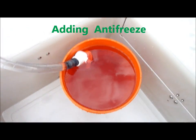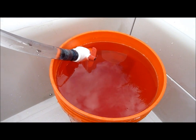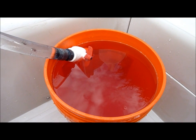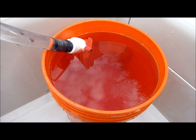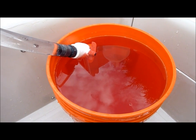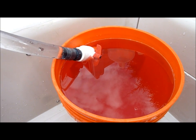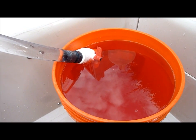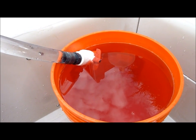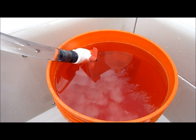So what I've done now is I've filled my in-out bucket, which is now just an in because I'm not feeding it fresh water, with propylene glycol, to run through the engine. I know from experience with this engine that it takes about 5 gallons. That's primarily because I have a Seafrost engine-driven refrigeration system that has a lot of water in it. With propylene glycol, the last thing you want to do is let it get diluted. And I know with 5 gallons, when I tested out the exhaust at the other end, it's still at what it went in as. I know it's not diluted.